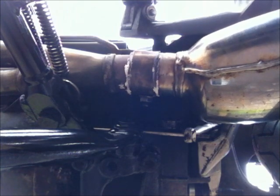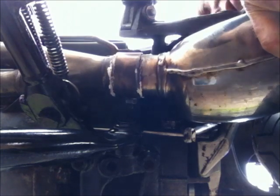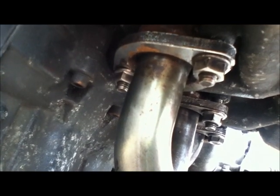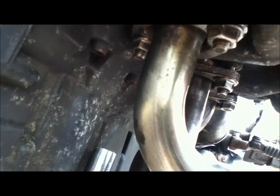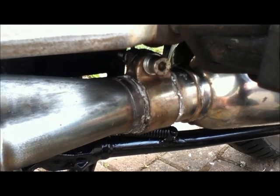Slide that into position and use the hanger to get it right into place. When putting the manifold back on, tighten all the nuts down nice and firm, then in pairs crush the copper gasket down so it's all nicely seated. It's worth coming back the next day and doing them again to make sure they haven't eased off. Finally do up the bracket really tight so it crushes the flange down and you can see all of the fire paste ooze out.